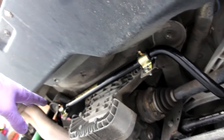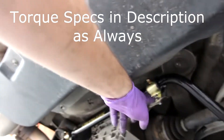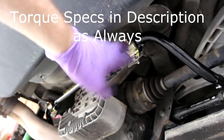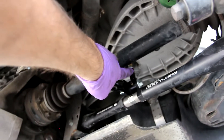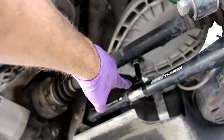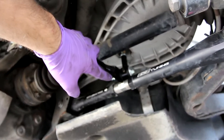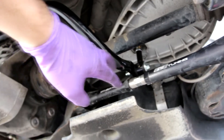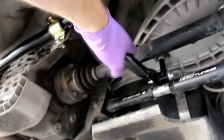So we've got the rear sway bar in now — we've just got to do the front. Quick torque specs: those are going to be 16 foot-pounds. They're not factory bolts; they come with the Hodgkin set, but it didn't say to do anything different. And then the ones up there are also 16 foot-pounds — so that's factory. This one doesn't have any specifications I can find specifically, so I did 30 foot-pounds on the bolt here, just because I had a friend at the track who runs a Miata and he let his nut walk off and his sway bar became disconnected — so that was their own little nightmare. Anyway, I'm going to put the car back down and flip it around, and then we're going to go do the front one.